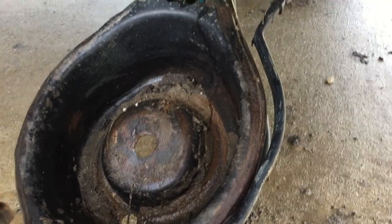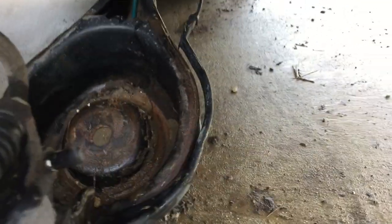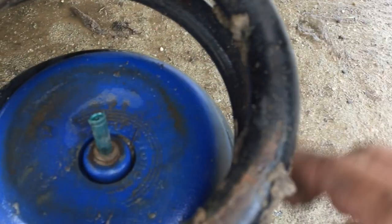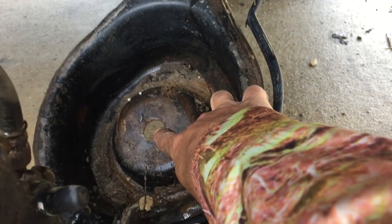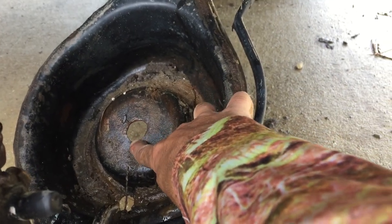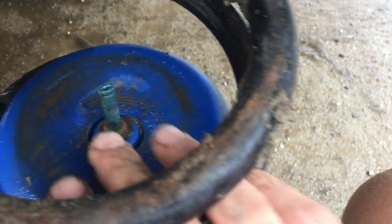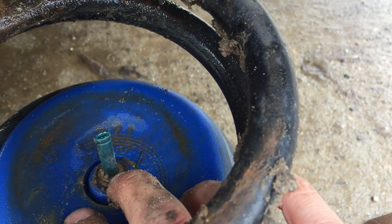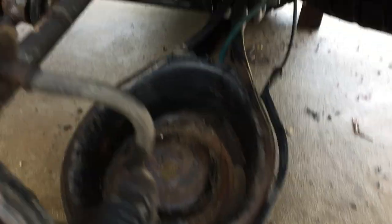If there's one thing to take away when you're installing your Firestone air spring: when I first drilled a hole for the hose that comes out the bottom, I drilled it just the right size and tried to precisely guess where it was going to be, which is hard to do. I found that if you just drill the biggest hole you reasonably can, that gives the hose attachment point — this macro fitting — plenty of room to sit where it needs to sit.